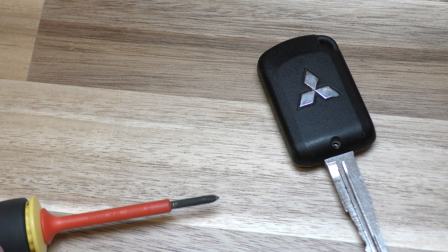There is a little black screw right here — I've taken it out. That's where you need the Phillips head. Next, I'm going to use the medium size flat blade. There's a little notch right here — you go in there, rock it side to side, and pull that Mitsubishi cover off. This is where the small screwdriver comes in handy.